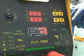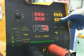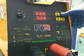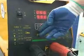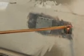The recommended power is 50% and time is 9.9 seconds. The recommended power and time data is on the operation panel. Make sure the carbon rod connects with the shrinking part. Press the gun switch. When the carbon rod gets red, move the carbon rod slightly till the over-stretched part generates sufficient temperature.